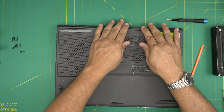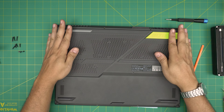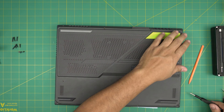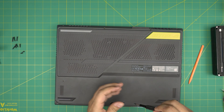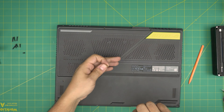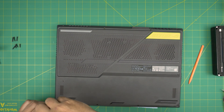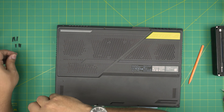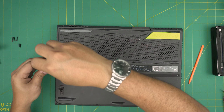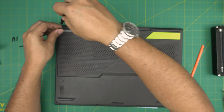Once you set it down, it should make a nice click sound on the left and right. Do not push down on the corner screws — just screw them down and the cover will pull itself in. Put the bottom screws back on. If you see any gap, pinch them together and it should be fine. If you turn on the laptop and it doesn't power on, connect the charger first, wait 5-10 seconds, and then power it on — it will work fine. I hope this video helped. If you have any questions or requests, leave them in the comments. Thanks for watching and I'll see you in the next video.